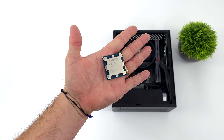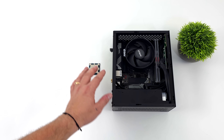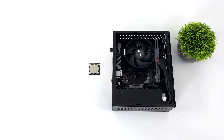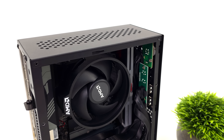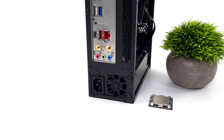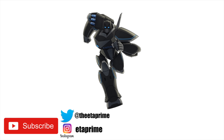So obviously the question is a bit loaded: can you game at 1440p on the new 8700G's iGPU? For a lot of people, you definitely could. There are people that don't want to run anything under 60 FPS, but if this is all you've got and you want a higher resolution, you could definitely get by with something like this, especially if you added a FreeSync display. I really do stand by those with these iGPUs — it's something these handhelds powered by Ryzen need. The ROG Ally has it, and even running under 60, it just feels like a really smooth setup. Even though we're not able to run higher-end AAA games at 1440p over 60 FPS, I think a lot of people would still be happy. But in the end, if you've got the 8700G, 1080p is where it's at. If you've got any questions or want to see anything else running on this new RDNA3 iGPU, let me know in the comments below. Thanks for watching.